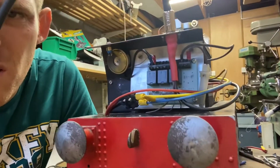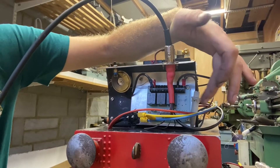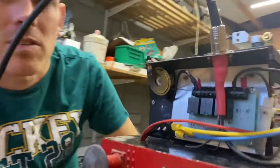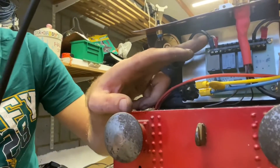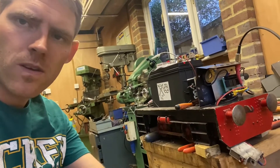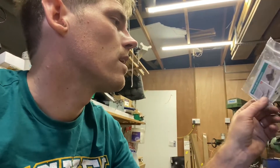So I've got the horn board wired in. It's got positive there which goes through a fuse back to the positive on the box, and the negative goes to the negative on the box — so they're just piggybacked off those terminals. Then the horn is connected to these. I do have a slight issue — it all works now, however as soon as you operate the horn it doesn't. They did supply a couple of diodes to put across the horn just to try and control any interference, so I'm going to try them. If not, I might be looking for a new horn.